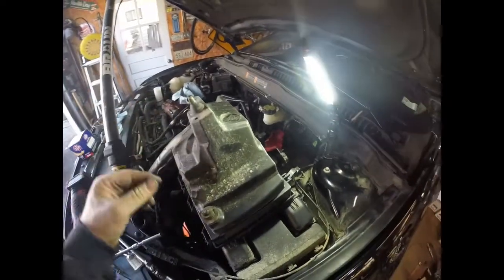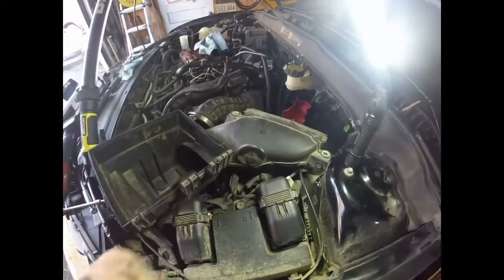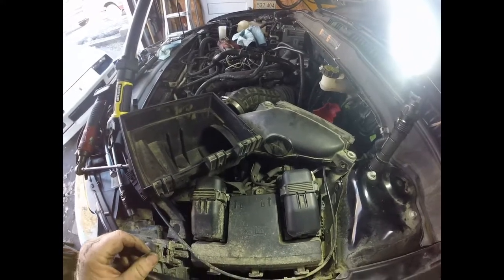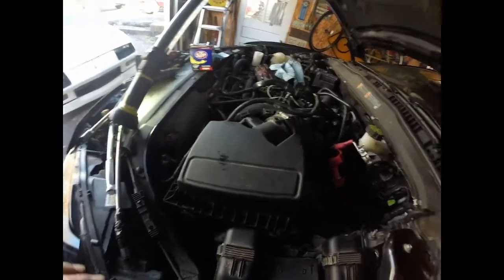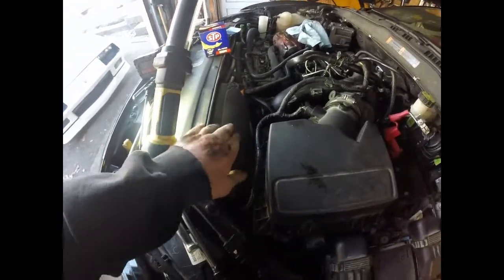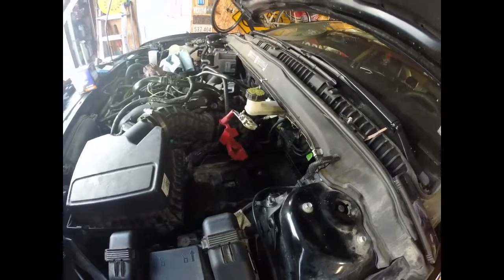This air box doesn't bolt in like normal — it has got these two tabs that push in, and you do have a couple of bolts for this front air dam that goes in, but other than that it just pushes in and it's pretty hard to pull out. You have to use a little bit of force to get it out, but it just pushes right straight up after you take those two bolts out. Once you push it down in there, you have got two 7mm long bolts that go into this air dam, then put the lid on, put your air hose on, hook up a couple connectors, slide the battery in, and we will be done up here.